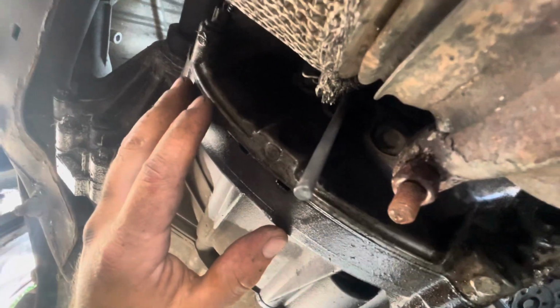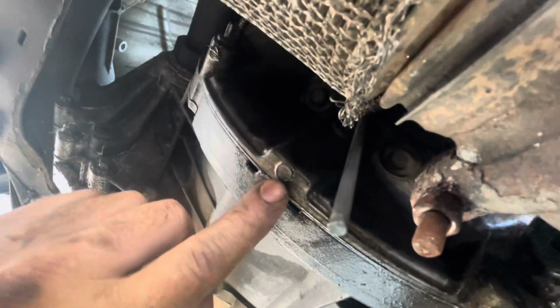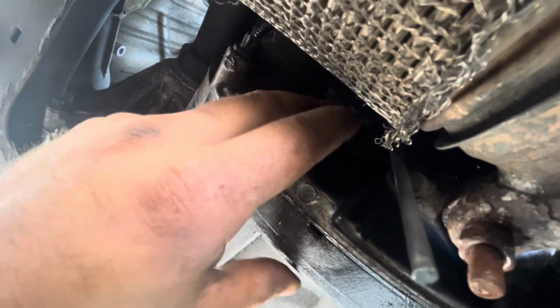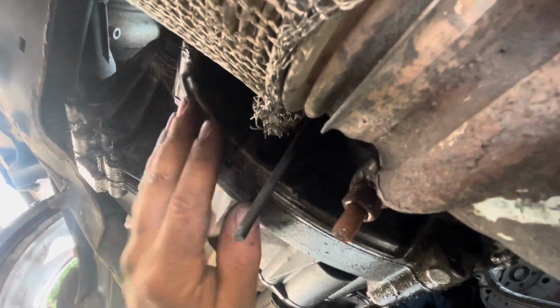Underneath the engine and beside the bell housing, just underneath the downpipe here, there are two dowel pin holes, as you can see here, and in the top one is where we want to locate the crank locking tool for the bottom end. Literally just slid in perfectly where it is, given it a couple of checks, and it seems okay to me. So now I've got the bottom end locked in place, we can go back up top and get everything off.